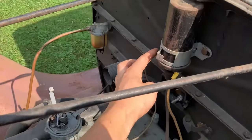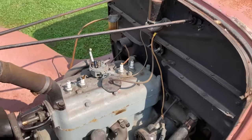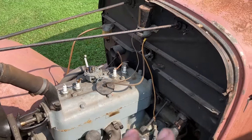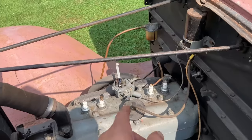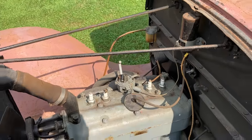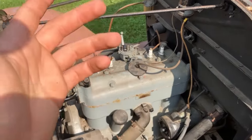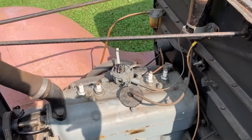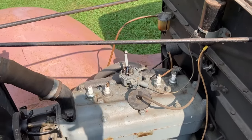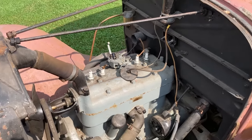There's also a wire that runs from the negative of the coil right into the distributor, taking the place of the whole ignition system. So basically, once there's a battery on it, it's firing. So I'm going to plug the battery in, see if we have sparks at the points. Took the plugs out, looked okay inside, bombed some oil in there, and pulled it around the yard with the four-wheeler a little bit just to make things move. And yeah, let's get some power to it.